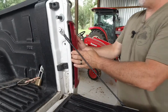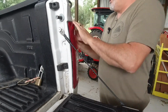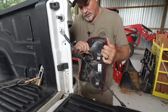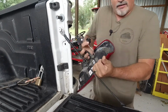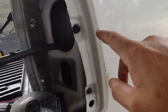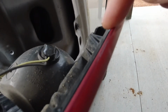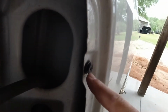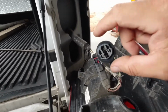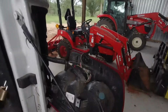Once you have two screws out, you do have to kind of apply pressure on this outside here, and it kind of pops off, but it's easy enough. I've already had the old one out to get the reference off of it, so that's why that doesn't have one. These are the clips here that slide into the slots on the tail light itself. So here's this. And then you just plug in your tail light in this slot here. Again, it's a 7443 from Sylvania that I'm using.